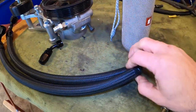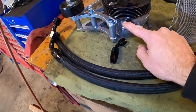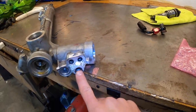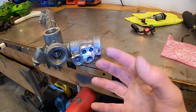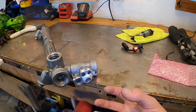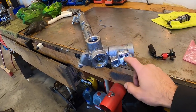As far as the AN6 fittings on the high pressure side go, we are not going to be using a typical rubber hose with a stainless steel wire wound liner. This is high pressure coming from the pump directly to the rack, so this is actually going to be a PTFE style connection — similar to what we're doing with the clutch line. This PTFE connector is going to be a high pressure plastic nylon lined application, which requires different fittings as well. I'm waiting for those to come in, which is why I haven't lined that up yet.